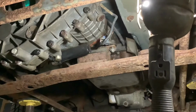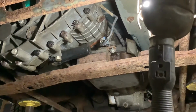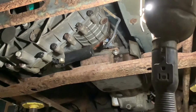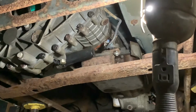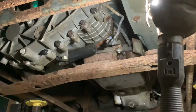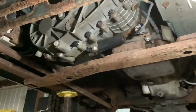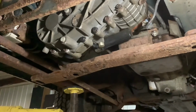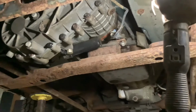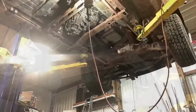Well, anyways, there were just a few of those winds of coil in each hole, so I just grabbed a 10mm tap and some longer bolts and chased those threads out and got it so it'll just thread in without that whatever, I can't remember. So now it's time to tighten up the crossmember. The bolts that are through the frame and through the supports are just loose as well. I wanted to get everything in place before I tightened it.